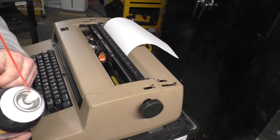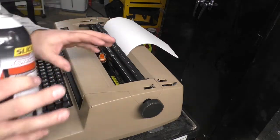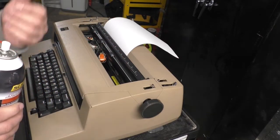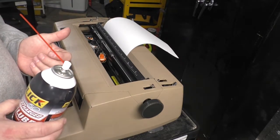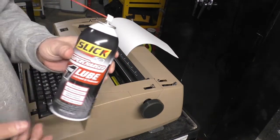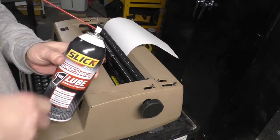So one suggestion I found was to take the clock apart without, see, I didn't want to remove the mainsprings because I don't have the equipment to do so. So I dunked the entire clock mechanism into an ultrasonic bath to clean out all the old grease and oil. Then you use your clock oil to lubricate the pivots, as you normally would during a normal service, but you spray a little bit of this lube into the mainsprings between all the windings of the spring.